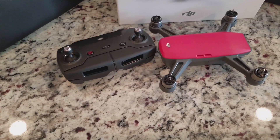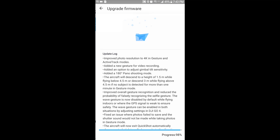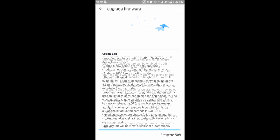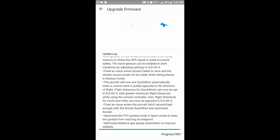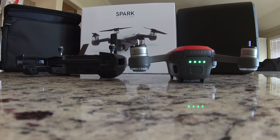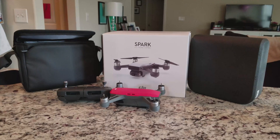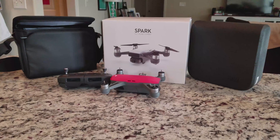Hey, what's going on everybody, it's your favorite introvert here. Today we're going to be talking about the DJI Spark — more specifically, the IMU calibration. You shouldn't have to calibrate the IMU often. It would be a good idea to recalibrate only if you were to crash and your Spark is unstable, or you're just getting the Spark and have initially taken it out of the box. I also like to recalibrate all the sensors after a firmware update, which DJI has recently pushed out. That's not specified by DJI, but it's something I like to do for peace of mind prior to flying for the first time after an update.